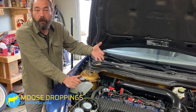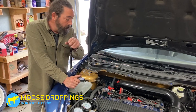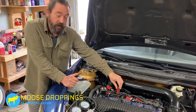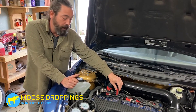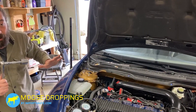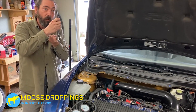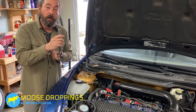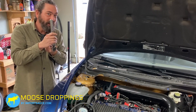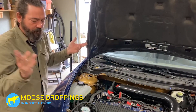It's a pretty solid tool. If we hear it coming into the cylinder next door, we know the head gasket may be bad. One by one we pull the ignition coil pack — that's going to be your 8mm — then pull the spark plug with a spark plug socket, and stick a long screwdriver down in there. With the passenger side tire off, I'm turning the crank with a 30mm while someone watches the screwdriver come up. Once it gets to top dead center it will stop, pause, then start to go down. I just back it up a little to get it right at TDC.